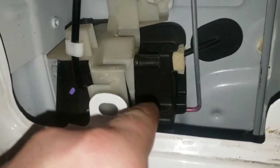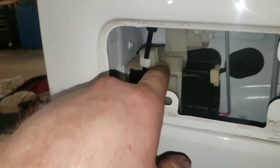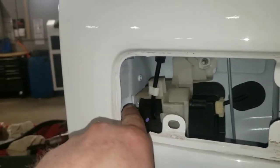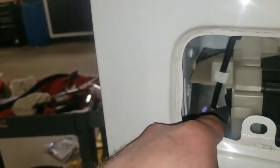The newer trucks already have the shield and the rod in there. What we have to do is go through and put a piece of foam back here, put a piece of foam on the other side, and seal around that whole entire top area. We put a little foam insert around this so it goes down to the lock and stops water and stuff from getting in there.